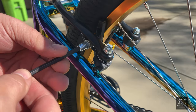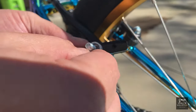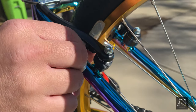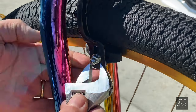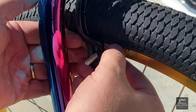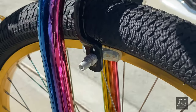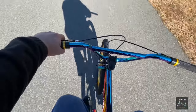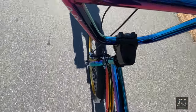Let's swap out those brake pads — we definitely don't want to ride with the black brake pads as they'll scar up the sidewalls of these beautiful rims. Putting on the Cool Stops. Those of you who use these clear brake pads know what happens — they make noise, they squeak and squeal. You can try to toe them in or whatever, they still squeak. I'm not going to make you hear that here, but I did ride the bike just to try it out.